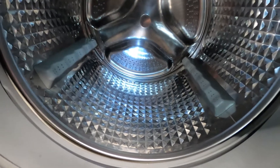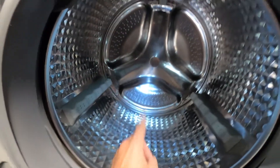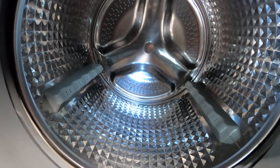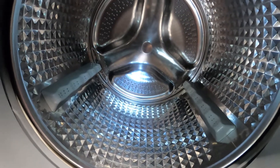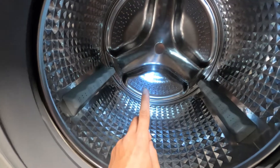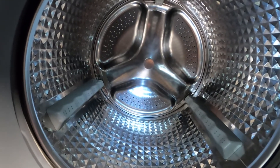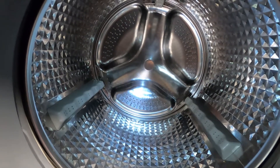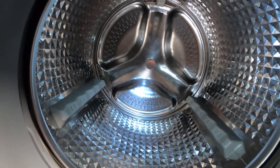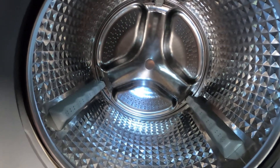Make sure you hit that self-clean, because if you don't you're going to run into issues. The spider gear on the back of the machine is made of pot metal and really doesn't hold up to soap residue. That soap can eat away at the spider gear, and that's where people run into bearing problems — making the machine sound like a jet taking off from the airport. If you ever hear that, it's a good indication you've got a bad bearing back there.